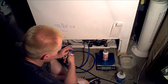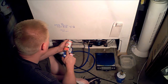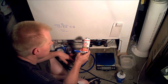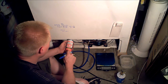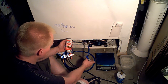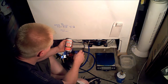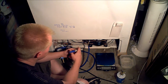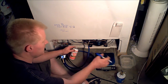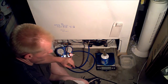The problem is, if I put this whole can in — these 3 ounces, or 85 grams — that's like a third of what the entire system holds, and I don't think I should have a third of this stuff running through the whole system. So I only want to put about an ounce in. It's going to be a little tricky because a three-foot quarter-inch diameter line like this holds about one ounce of fluid.